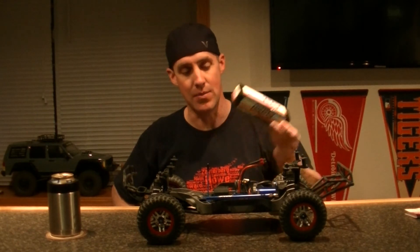While I was there, after I finished up my run, somebody else showed up to the track and they were running a Slash 4x4 with a three-cell 5,000 milliamp battery. After seeing that, the amount of power — that was a huge difference. I pretty much just went to the store and picked up a 3S 5,000 milliamp, because honestly, that's what this truck should have.